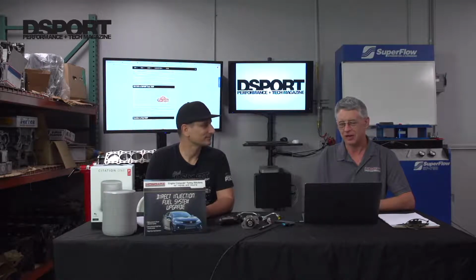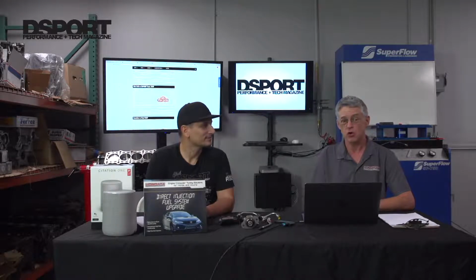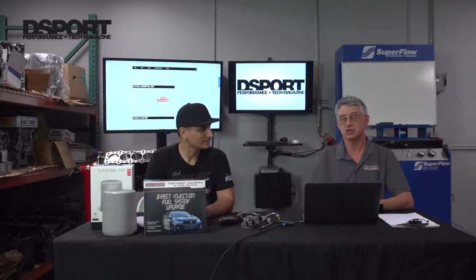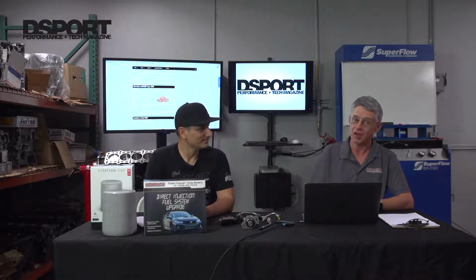So yes, I'd love to see something for the Accord, but I'd like to know what kind of Accord you're driving. Is it the 1.5 litre? Is it the 2 litre? Because the 2-liter Accord block and head is so close to that of a Civic Type R, and it's got a lot of potential. But in the testing that I've done, yes, we run out of fuel on that. When I upgraded my Accord with a Civic Type R turbo, which is a lot of fun, and put flex fuel onto it, it was running out of fuel. So I know for my own car that it needs more fuel.